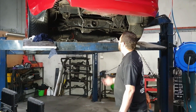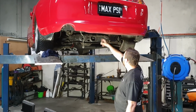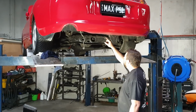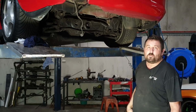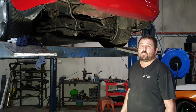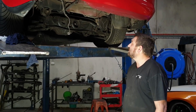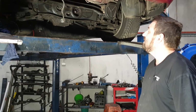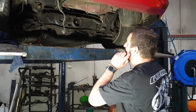That'd kind of suck. And the other thing you've got to consider is my MAC valve is going to have to be where the wastegates are, but the wideband really shouldn't be in the front pipes. It's going to have to be back here as well, in the dump pipe. Yeah, because wasn't that an issue? Otherwise it melts it. Well, yeah, I'd say so. Melt the hell out of it with all the heat, because half the trick is keeping the heat in the pot.